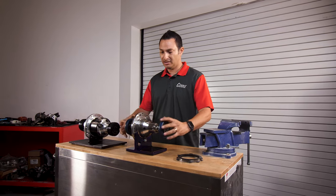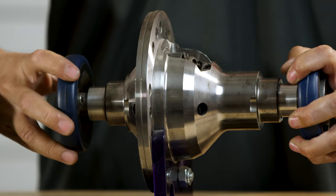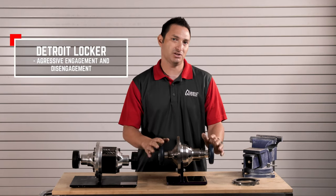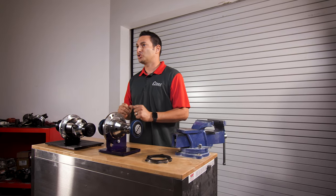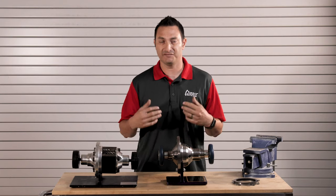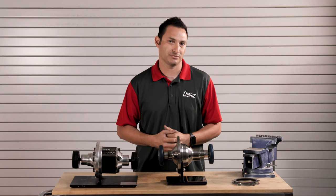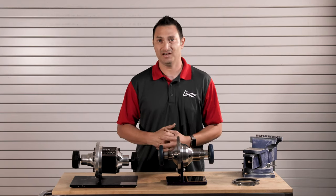When they push together and lock, it's a full type of spool — both wheels will spin at the same rate. As you turn left or right, they'll pull away from each other and let one spin. But you hear that clicking as you're doing it, and then when it spring-loads back into place, you might feel the car move a little bit in the rear, or a loud clunk. That's the typical activation of the Detroit Locker. It's a great carrier if you're a dedicated drag race car that wants to drive home after racing, and it can handle a whole lot of horsepower. It's available in 31 and 35 spline.